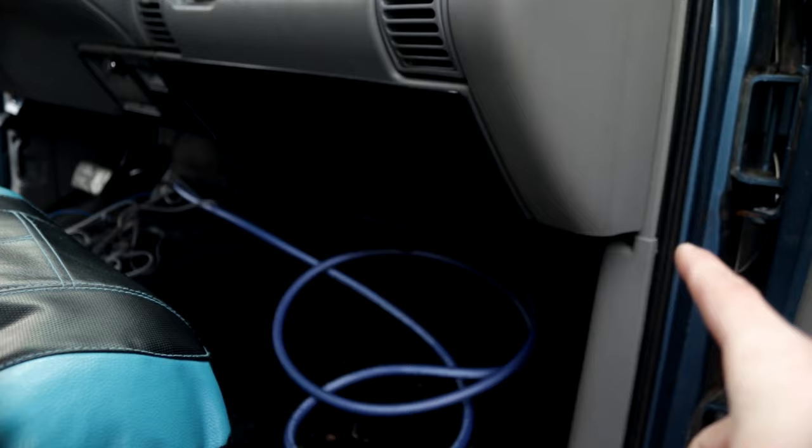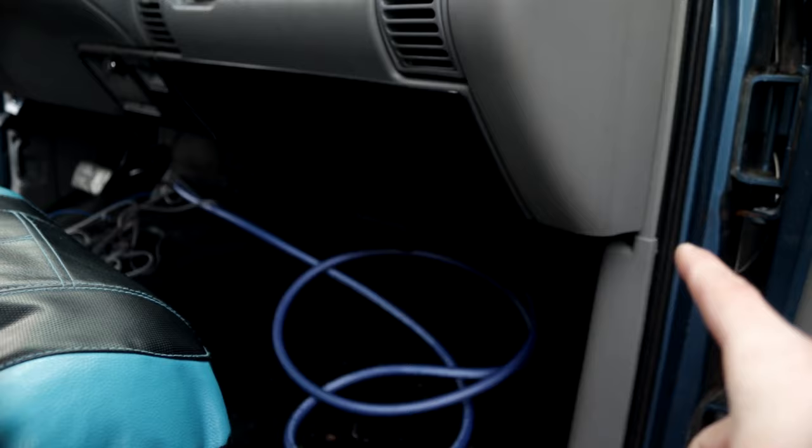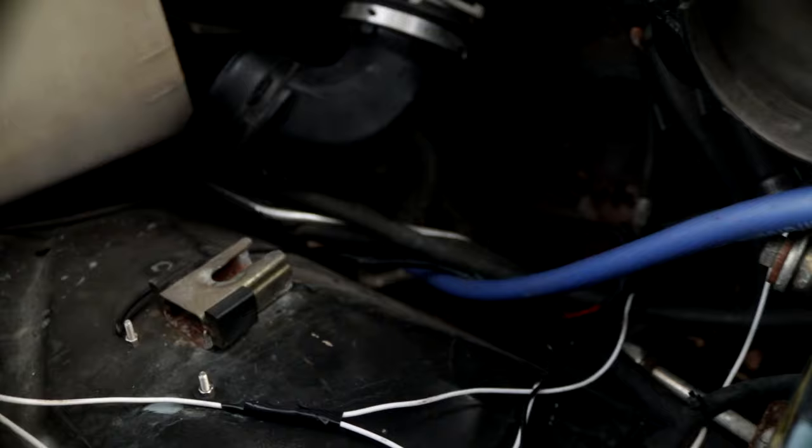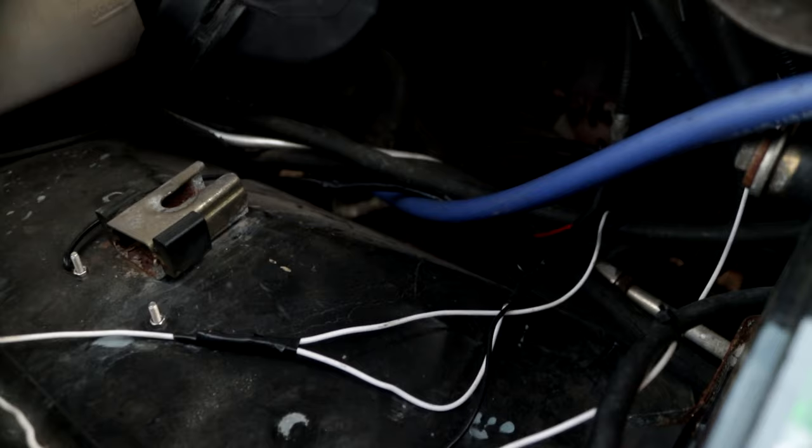Now we're going to focus on this main power wire — we need to get this to the engine bay. To do that we have these little firewall grommets for zero gauge wire. You slide your wire in and it tightens up with this rubber piece. We need to drill our hole right here in the passenger footwell, under the heater core right above the carpet — then we can go up to our battery. Power wire is ran through. Next thing is to wire up our fuse block right here. We're going to run it right here underneath the airbox, put it on this fender liner, run it straight to the battery. You won't even see it. Everything will look really nice and clean.